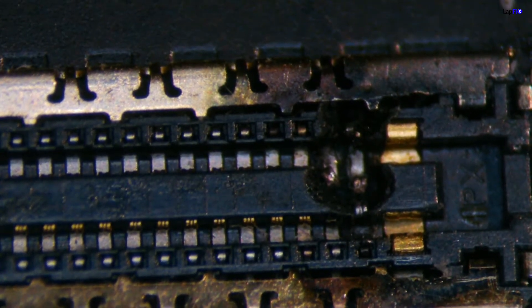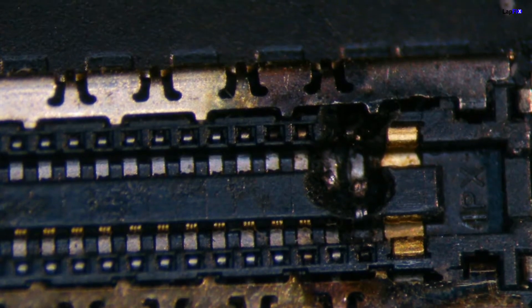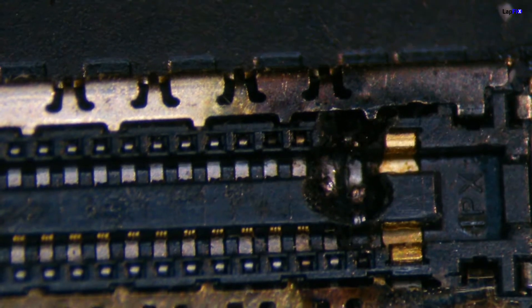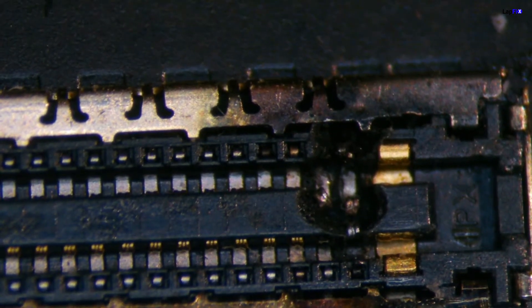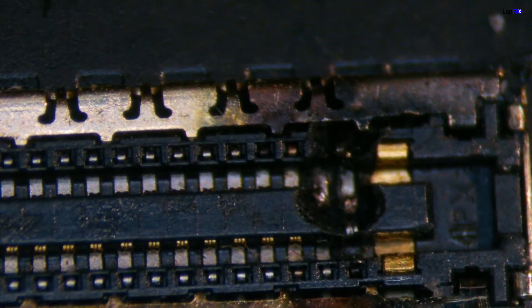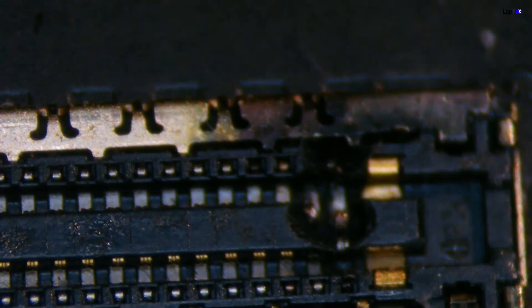Most of the time you'll see something like this — this is actually a burn to the connection itself, and the burn is on the board. This happens a lot when there's liquid damage in that area and people plug it in and keep using it. As they're using it, this can happen. Sometimes you'll smell smoke, and eventually you can damage not just the connection but the internal parts as well. This damage is pretty extensive because this isn't an easily removable piece — it's actually soldered to the board — which significantly reduces the chance of a successful repair.